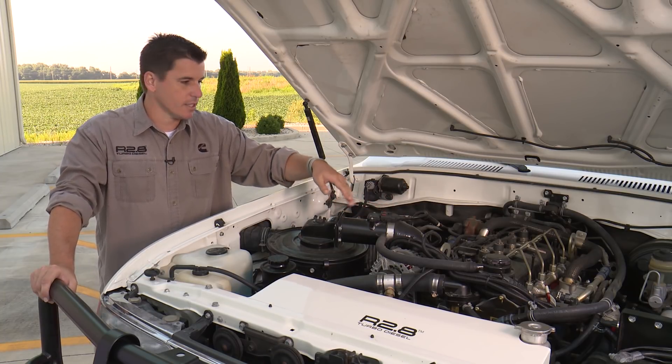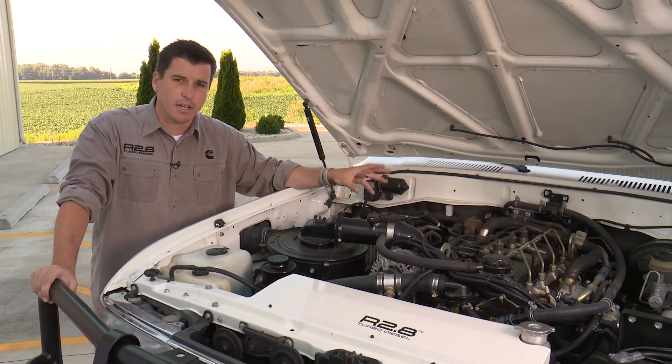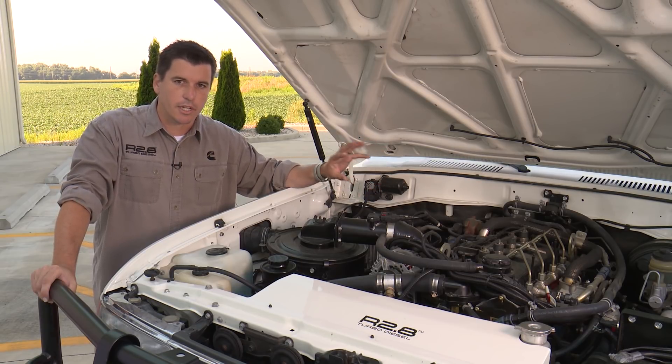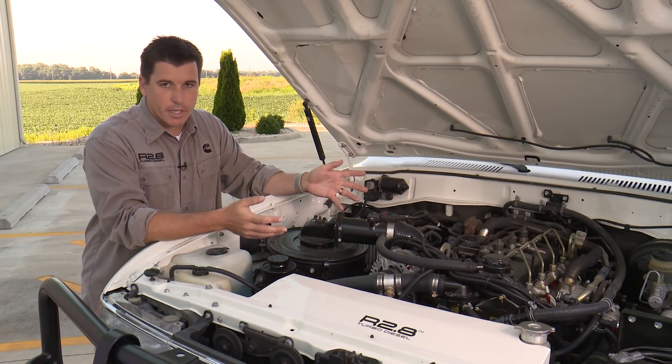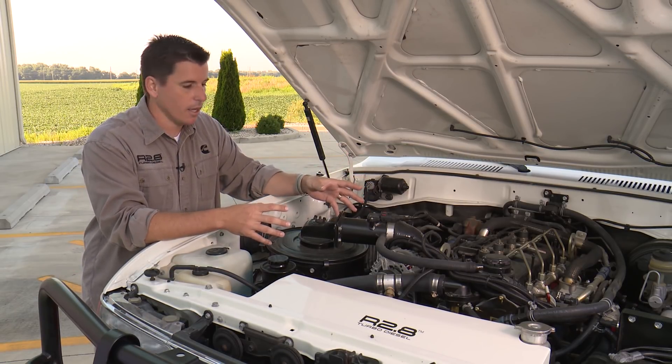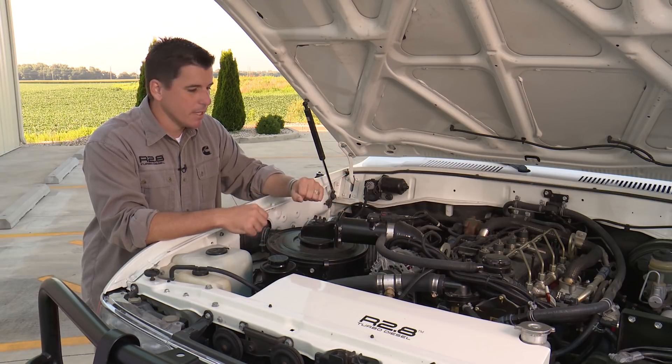The sensor is very important because it can really dictate your low-end performance on the engine and EGR flow rates. If you have a non-conforming intake system or a bad MAF system, you can have a lot of stumble on the bottom end.